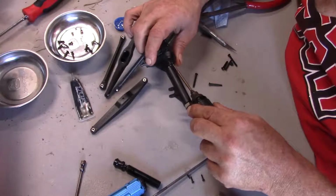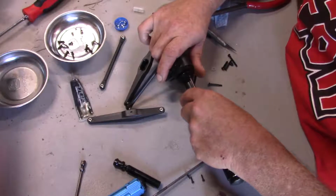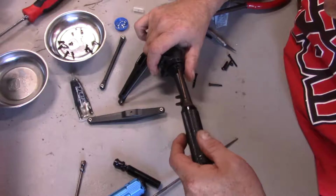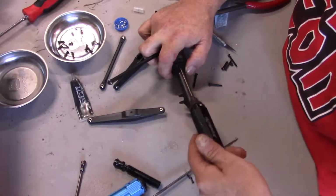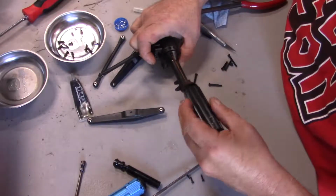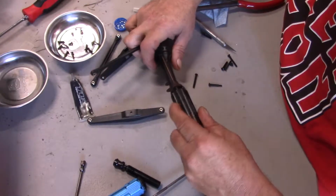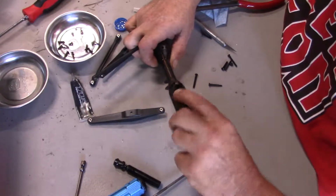So you may need to pull it out a little bit. Screw in there a little bit farther so you can see where the hole is, and get it lined up so it'll start the threads. And here again, like the differential carrier, actually with this one, once you get one screw started, the rest of them should go and all the holes will line up. So you don't have to leave one loose in order to get everything together. Okay?